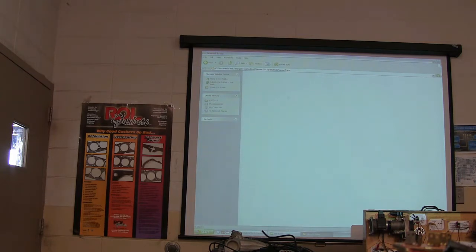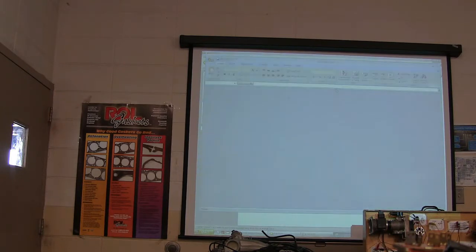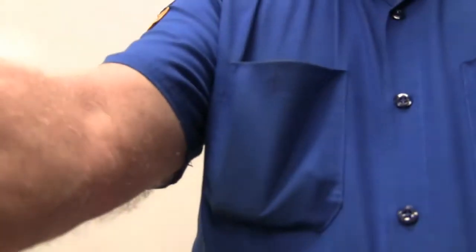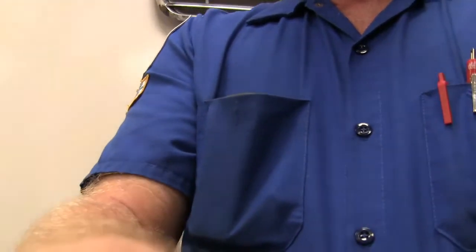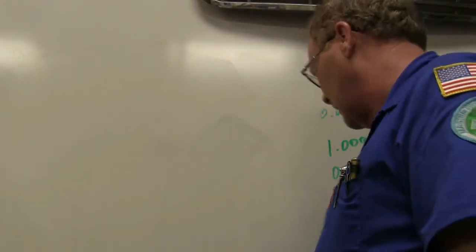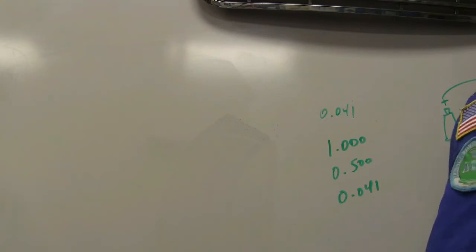It said cars with higher power will require fewer gears. Why do track race cars have six speeds? Well, you're basically wanting to keep the engine in its power curve. It depends, though. A lot of the people that drag race will have like a 2-speed automatic transmission in there, stuff like that.